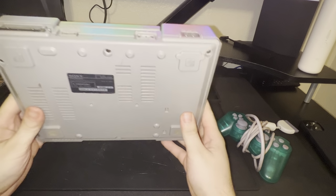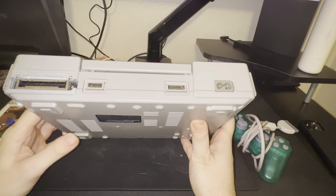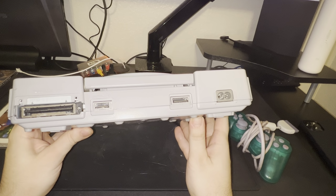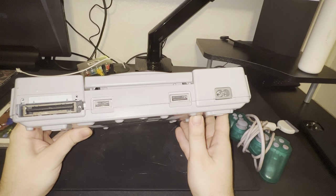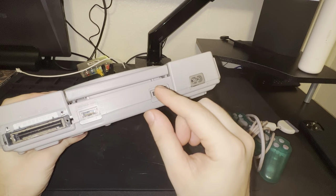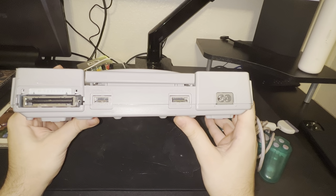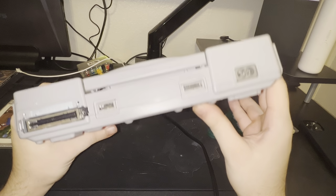So it seems like almost everything is working on this particular console. In the next video of this series, we can go ahead and take a closer look at the optical drive and troubleshoot it and maybe toggle the gain and the bias. There are two potentiometers that are on the board that are near that CD ribbon cable that we can go ahead and take a closer look at.